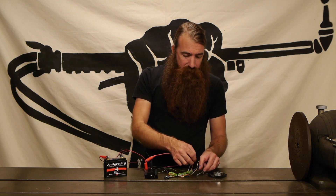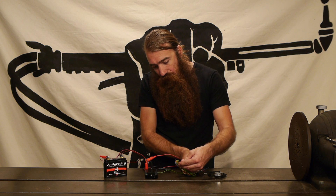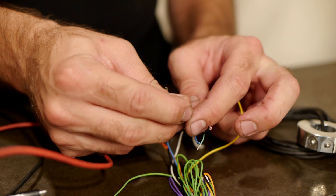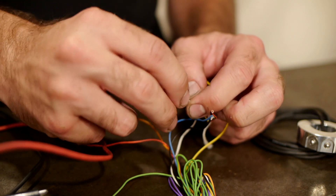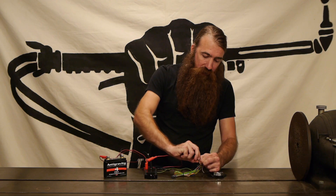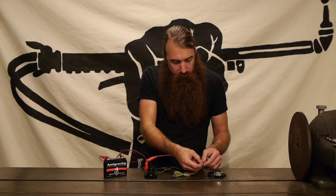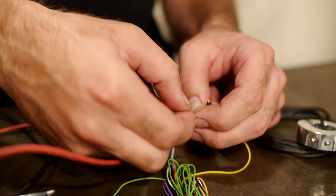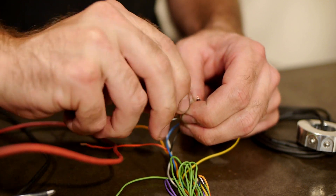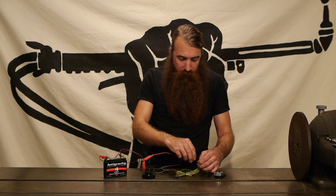So we've got the grounds connected. Now I'm going to connect the white wire from the M button — the white is the right-hand turn signal — and we'll connect that to our M switch mini. I'm doing a very half-assed job of these connections just kind of twisting the wires together. This is demonstration purposes only; when you're wiring a bike do it better than this please. Next we'll connect the blue wire — the blue wire is the starter button — and finally we'll connect the red wire, which is the horn button.